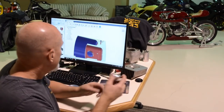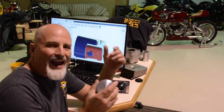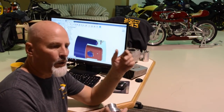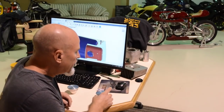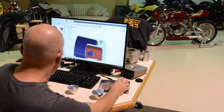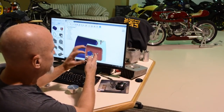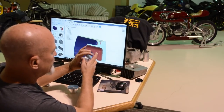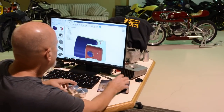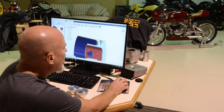So I made piston domes. Didn't quite finish it — we still got to do the mill work. I added some machining stuff just for the fun of it, just to kind of show you what's going on. So I've redesigned the piston. Instead of having the screw-in insert, it's going to be a one-piece. The pin boss and the dome will all be one-piece, so it gets rid of the hassle of threading that all together. And then the skirt will thread onto the dome.